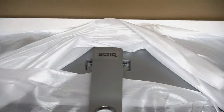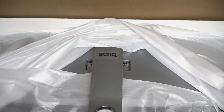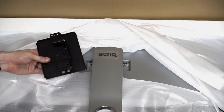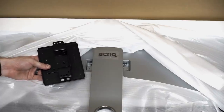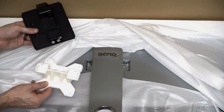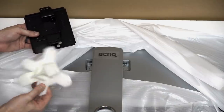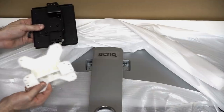So this is something a lot of people have been questioning with BenQ monitors in particular. We're removing the factory stand using the four screws behind the cover, and replacing it with a VESA mount from BenQ themselves. BenQ supplied these monitors and managed to track down what they said was the very last remaining VESA mount — the factory that was manufacturing them went out of business. However, they supplied a CAD file that allows you to 3D print your own. I printed these with a mate who had a high-quality printer, using PLA with 80% infill due to shrinkage issues at 100%.